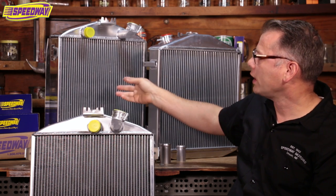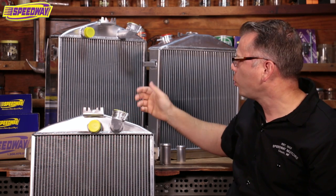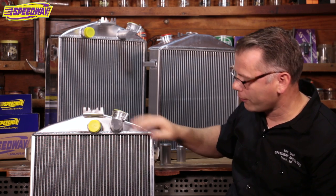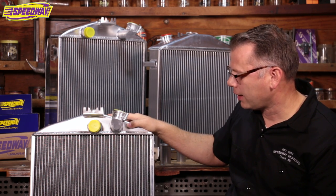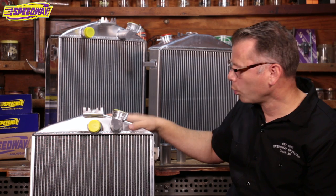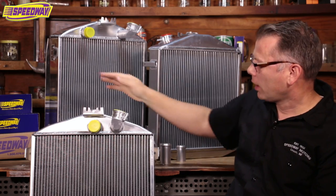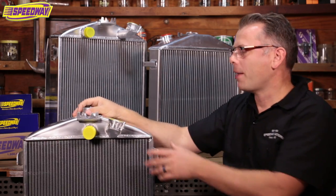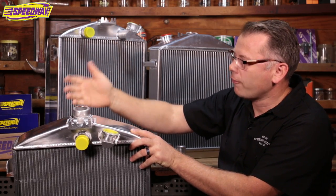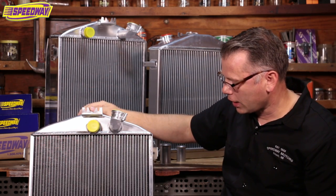You could also go to the 22-and-a-half-inch radiator, but the kicker there is you lose a little bit of your core. It'll still cool the car pretty well if everything else is as it should be, but I like sticking with the stock style — it fills up my grille shell nicely and just looks right. Of course, I've painted mine flat black to blend it all in. We've got them in the 27-inch, 22-and-a-half, and 21-inch. The neck is perfect — I put it right on my grille shell and my radiator cap spun right in there. It's a dummy neck, doesn't do anything functionally, but it's welded right in the right place and it's got all the provisions for your strut rods and everything else you'd need.